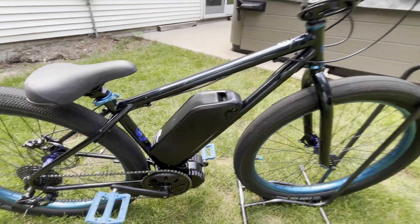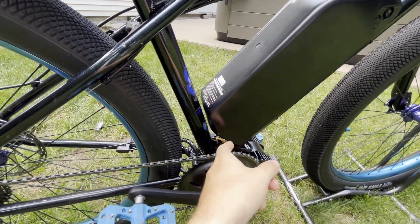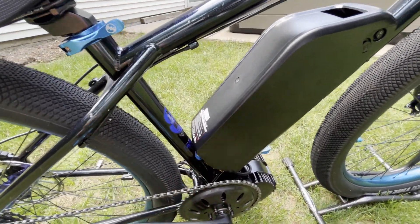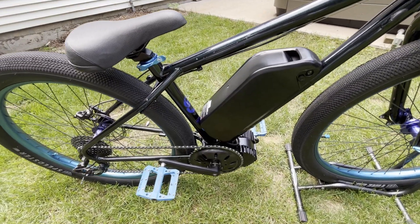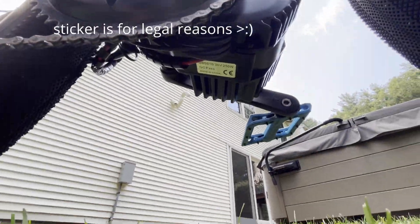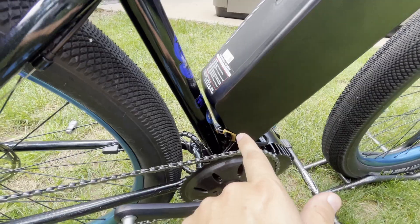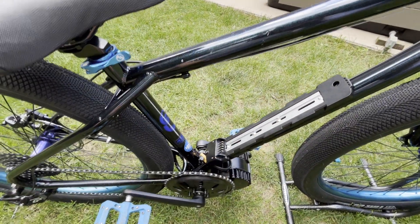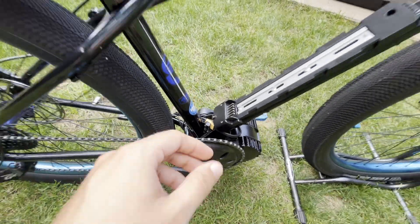You have an opening right here which I still have covered up because I'm not using it, and you also have an opening at the bottom. Since I don't have a dropper post and I'm not using this internal routing, I actually opened up the little hatch at the bottom of the downtube right here — which is where the dropper post wire would come out to connect to the seat post — and shoved all the wires I'm not using up into it. The wires coming out of the wiring harness of the motor were pretty short, so they managed to make it into the hatch, but not all the way in. So what I did was when I mounted the battery plate, I made sure to push it as far down as I can.